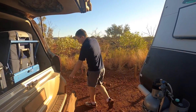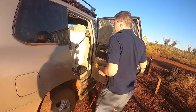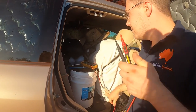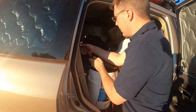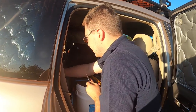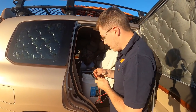When you've got 12-volt problems, always start at the point where it plugs in. So we'll start at the plug of the fridge and see if we've got 12 volt — and we've got nothing. Nothing is never good. Next thing to do — I've got a little power board down here.